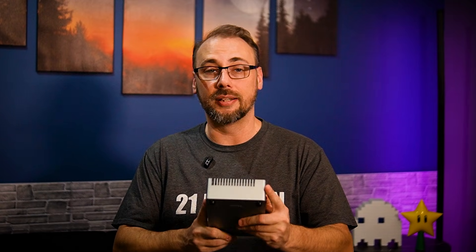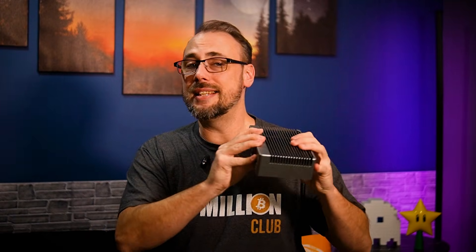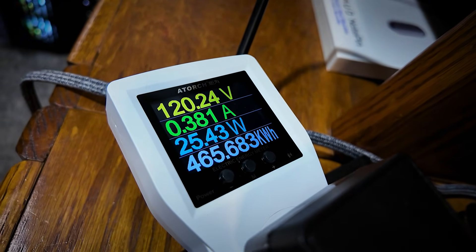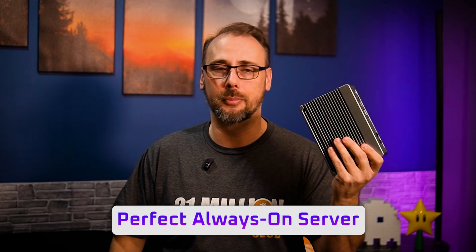The thermals on this actually ended up being a lot better than I expected. Under heavy benchmarks, the hottest point on the heatsink top fins was only about 108 degrees Fahrenheit. It got warm but never too hot to touch. Cinebench and Geekbench loops kept it in that range without any alarming spikes, and even under those heavy loads it stayed within that 38 to 46 watt window — so for an always-on mini server, that's very manageable.